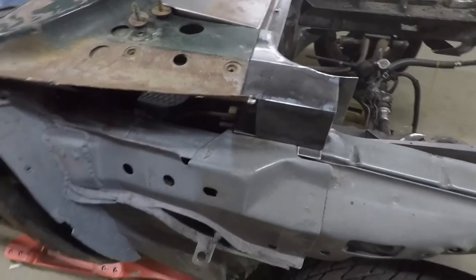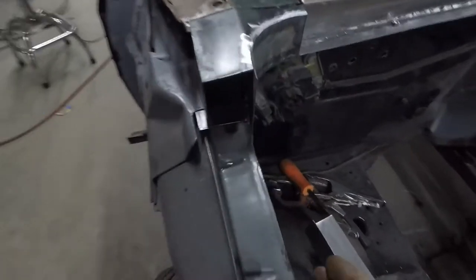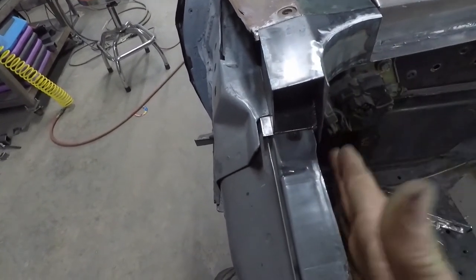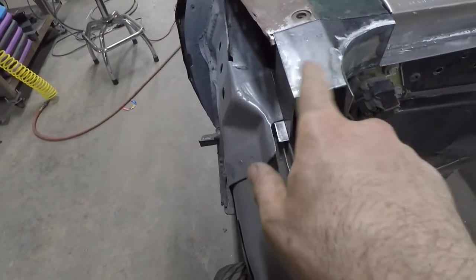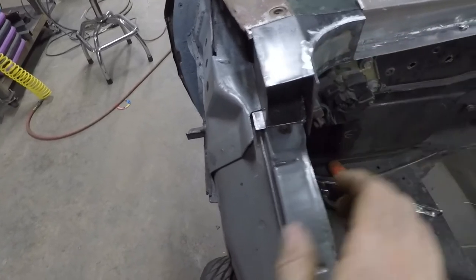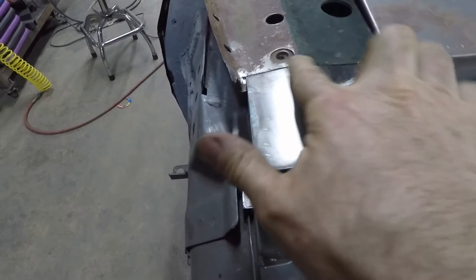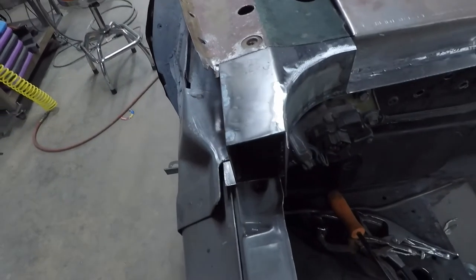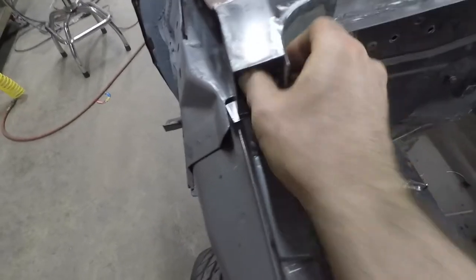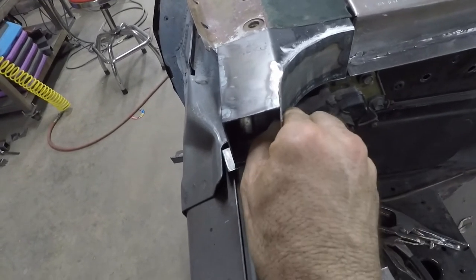I forgot to pick up my camera earlier, but what I've been working on is a nicer piece. I just made something in sheet metal as a concept and it worked okay, but now I wanted something with a nice radius that blends into where the fender mounts. I made this — I think it's 60 thousandths — measured something up and put a three-and-a-quarter inch radius on it. Kept playing around with the length, made a top piece, and bent it to conform with the body itself. I welded it on the inside all the way around, and then we can come back with a thin layer of Bondo just to hide that seam.